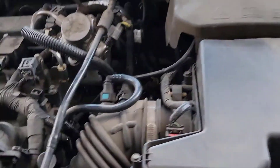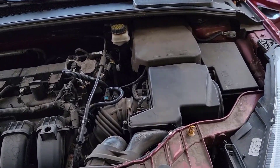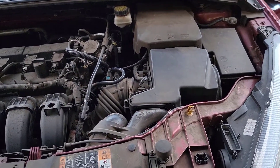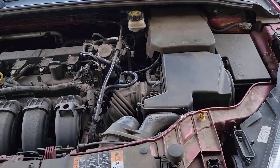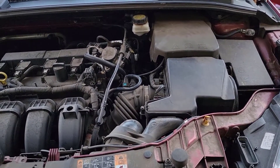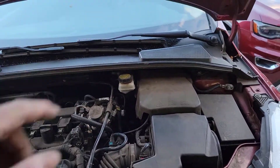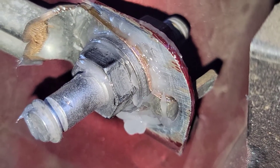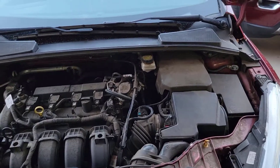But now I'm at the point where I'm indecisive — is whether to just go ahead and use it the way it is, or should I actually disconnect the ground, wipe the computer, and make it all relearn. Evidently these have to relearn. But I don't know how the memory is. I don't know if unhooking the battery makes that DCT have to relearn or if that's like in an EEPROM that you have to clear. I did notice when looking up some information there is a way to force these into relearn mode — I'd rather just do that. I did have some sauce to smear all around that bare metal, so let's leave that on there. I guess I'll just not clear the memory and see what it does.